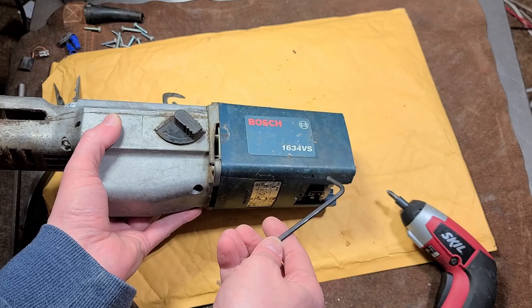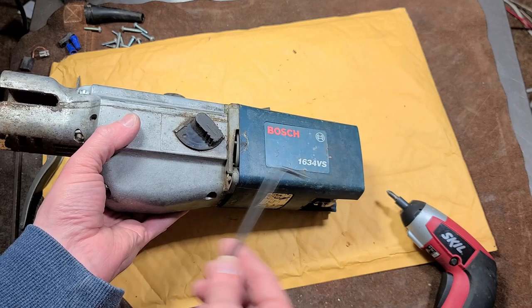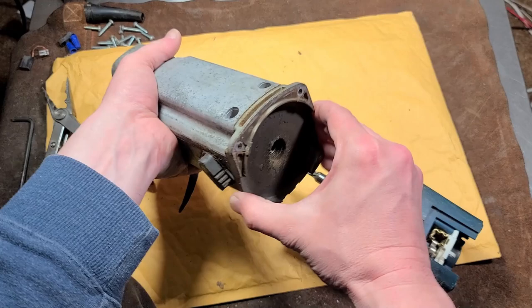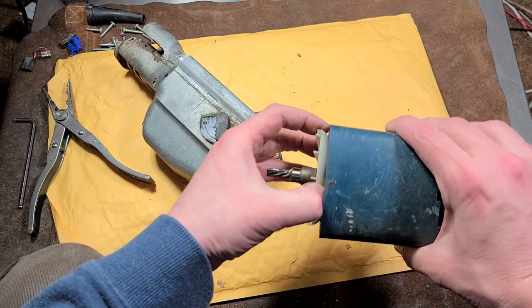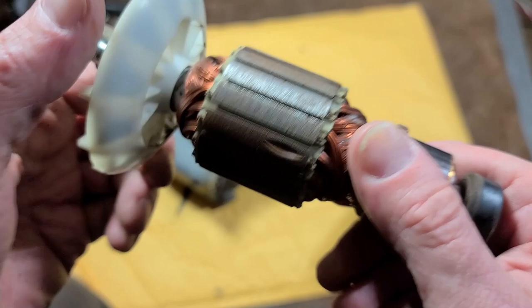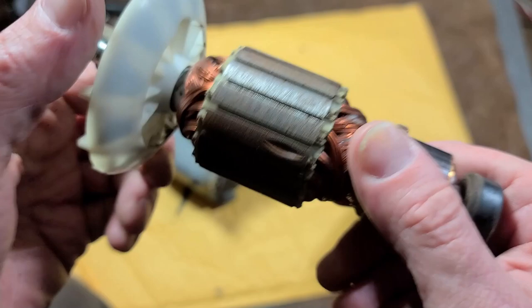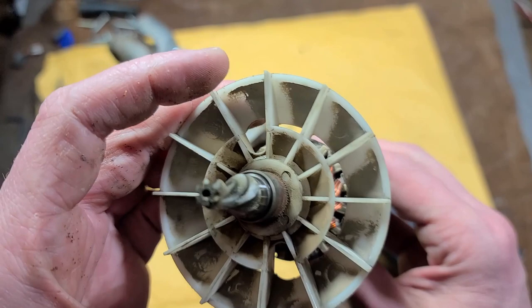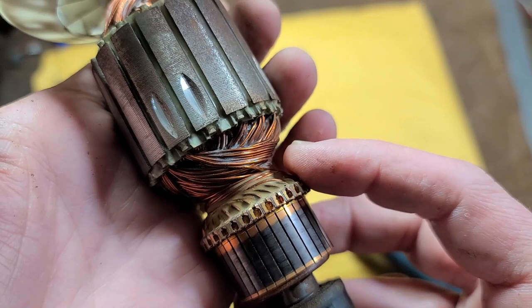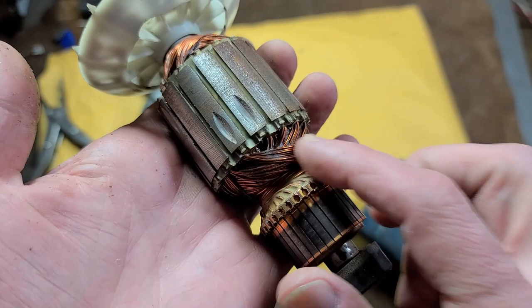What I should do is pull off this motor housing first. It looks like a pretty decent job — it's self-contained, and most of the parts that move are in the gearbox with just a motor attached. Got those fasteners out of there, and look — the motor just pulls right out of the bearing. How convenient is that. So here we have our motor and we can ease it out of the gearbox. This has definitely been outside or in some work trucks — some humidity has caused a little bit of corrosion on the motor. Some normal undercuts for balancing, but that's actually not too bad at all.